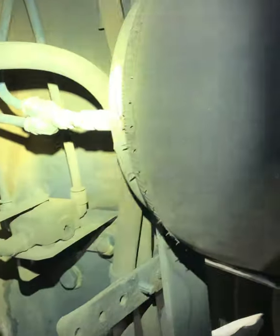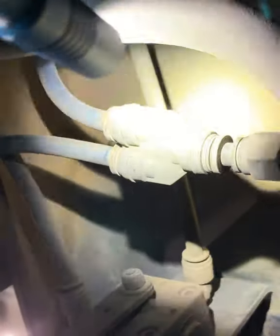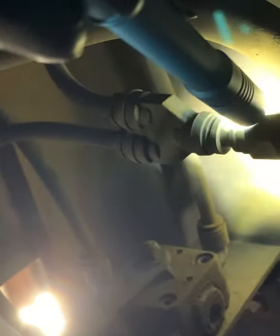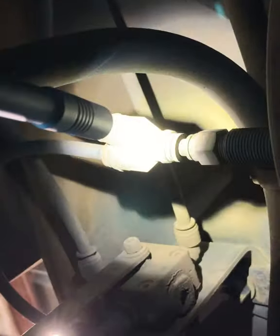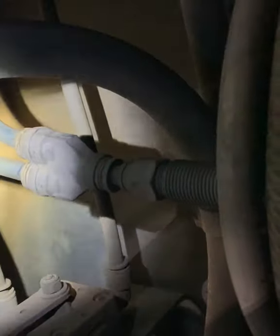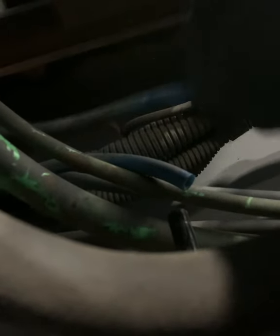Alright, so here we are crawling underneath the truck — make sure it's chocked, because you don't want to take any chances. Here's one airbag. As you can see, it's got a live fitting — someone's got a very unique setup going on here. I'm sure this was supposed to be a screw-in fitting and they didn't have the right fitting, so they just used a brass fitting screwed into it, then a Y-fitting with quick disconnects all along to get into it. It's ghetto, but it works. We're not going to do that setup. Disconnect these air lines on both sides and then we can go ahead and unbolt this sucker. The fittings and lines were crazy hard to take out, so I just used an airline slicer and cut them off — I'm not going to sit here and fight these suckers. The air lines are out, now I can unbolt it.